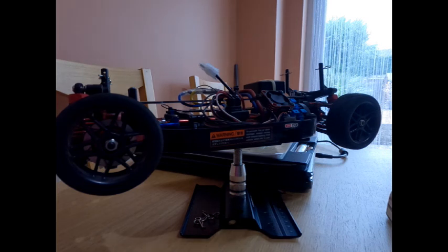High speed bearings are a myth, maybe. And the one-way clutch is a pain in the ass for braking. I've still got to work that out. I did some ABS adjustment. It probably wants a little bit more endpoint adjustment, to be honest, on the braking, so it's constantly braking but lighter, so it doesn't sort of throw the car around. So yeah, we'll get in there.